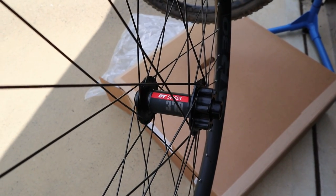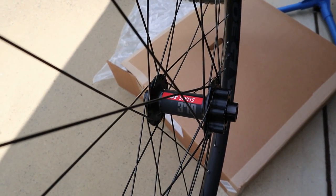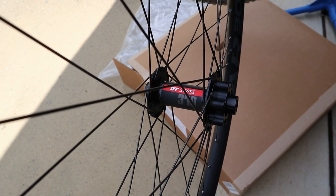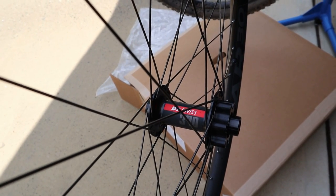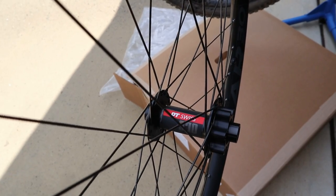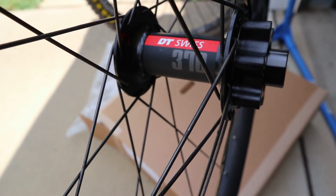The DT Swiss 370s are just budget hubs, and if you're used to high engagement you're just not going to be satisfied. I did ride them — they rode perfectly fine — but I'm so used to almost instantaneous engagement when I go to pedal. For me, I'm really keen on the sounds bikes make. When you don't get immediate engagement, there's a bit of free time where all your torque goes into nothing and then it makes a clang sound when it does catch. It's quite noticeable when you're trying to inch your way up rock gardens doing what I call quarter-pedaling or half-pedaling. But for folks that don't care about that, these are probably pretty good hubs — DT Swiss has always made good hubs and wheels.